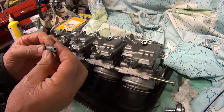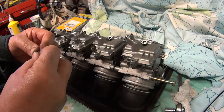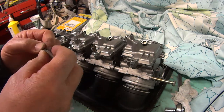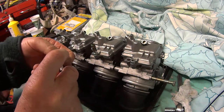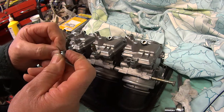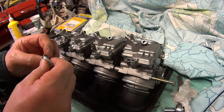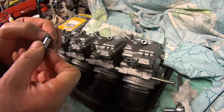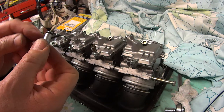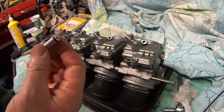there we go, that's one, that's two. You'll probably see with your old seals though that they do get cruddy around the edges where the petrol sat, and if you move them apart a bit you can see they've got little cracks in, so they leak.